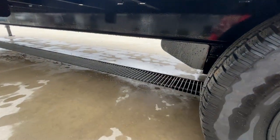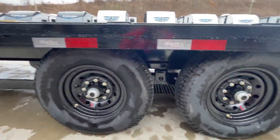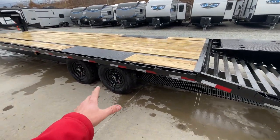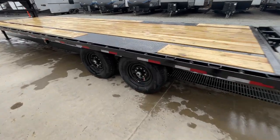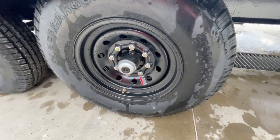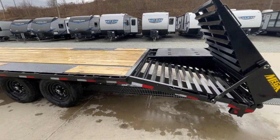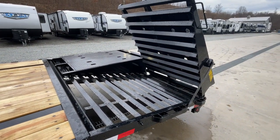There's also a reinforcement on the front side of the front axle hanger for extra support. If you do your own service, 80-pound air in the tires is your max pressure. I believe this has 9/16 studs instead of half-inch — a little bit heavier. Those are going to take about 140 foot-pounds on your torque if you're taking your wheels off.